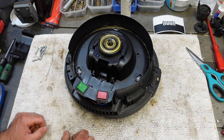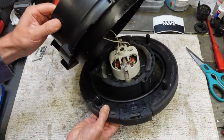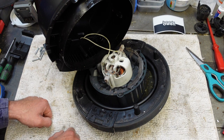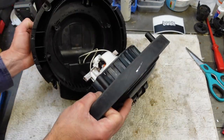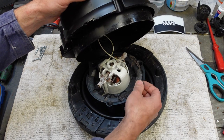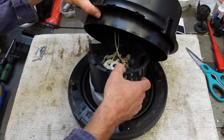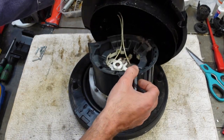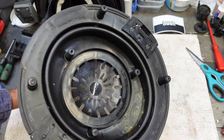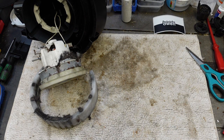So I need to get into the motor - there's some little insect roaming in there. I need to lift this one off like that. So I was lucky that I had taken out those three screws and I immediately see a load of rust. That'll tell me that something's not good on the brushes. Let's have a look at the commutator - it's there, so it's not too bad. There's a bit of dust on that filter. So let's try and lift this out. It looks like something got wet in there at some point. There's a lot of dust coming off this - a bit of wet over there. I'm going to get the other Henry to give this a clean up now.